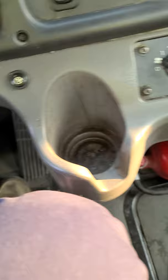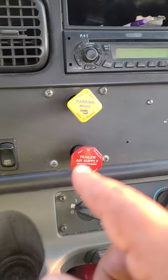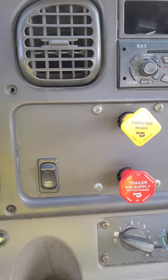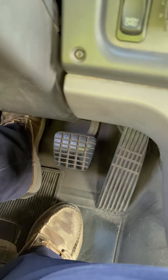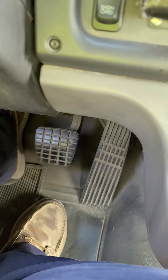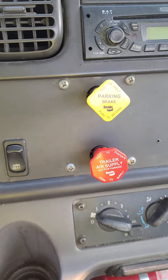After putting it in second gear, release the trailer brake. I always like to test from top to bottom, so I'm going to test my parking brake first, releasing the trailer brake. For this test to be successful, my parking brake should hold this vehicle combination in place. I'm going to release the clutch slowly — not pressing any other brake — and once I feel the vehicle try to move, press it back in. This is a good test: my parking brake holds this vehicle combination in place.